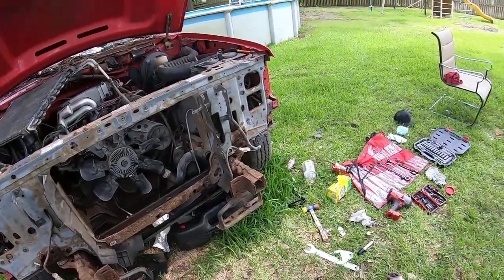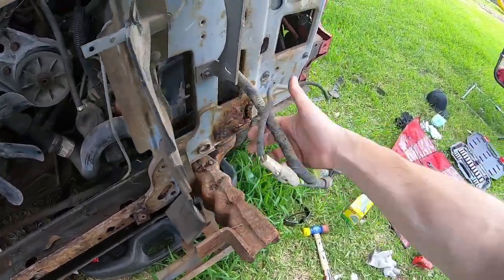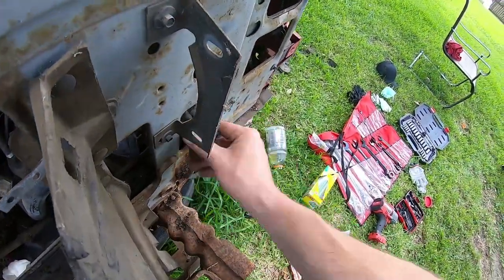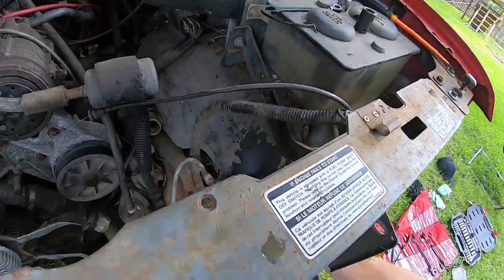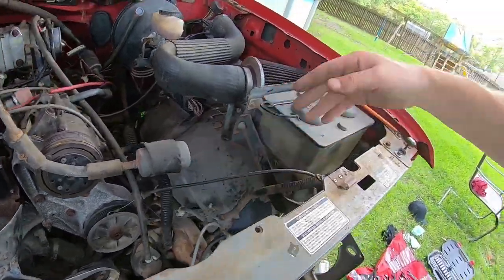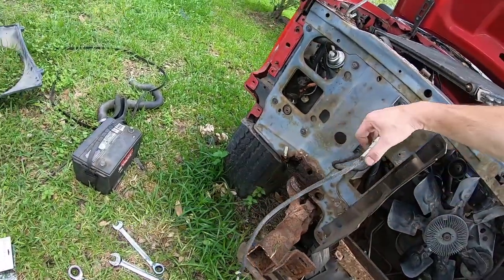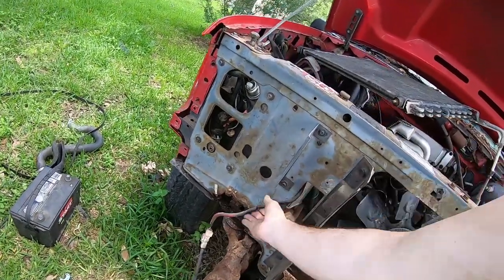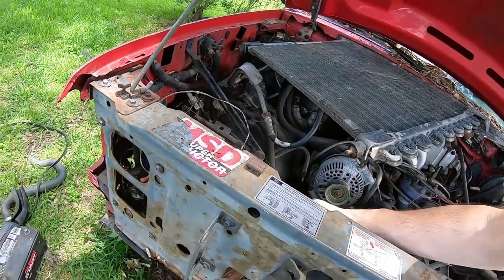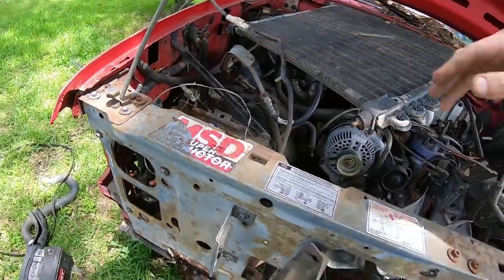The GoPro was not my best friend - we've had some issues. This is actually the next day. This is a wiring harness for the headlights and fog light - we want to make sure it's out of the way, we're going to tuck it back. As you can see, the condenser is out. Two bolts underneath, three on the back - we basically just peeled it back and pushed it on top of the intake. We didn't really detach anything besides what I was working on. This is a fog light - somebody tapped into it and wired stuff. We're just going to pull that out of the way, tuck it up. You see the condenser up top there.